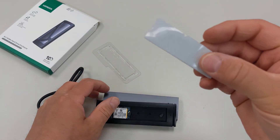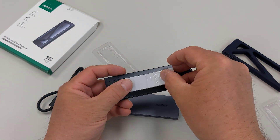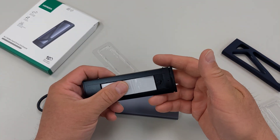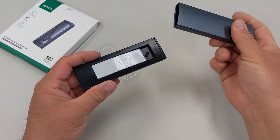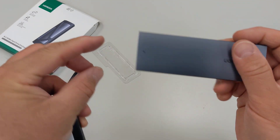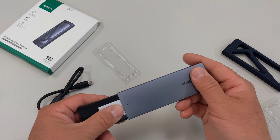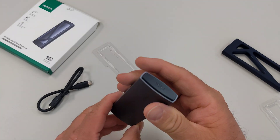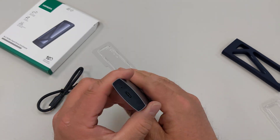After that, there's this thermal block — I'm going to put this cushion right over top of the drive. That will give it some cushion for being in here and also protect it from vibration and act as a heat transfer medium to get heat from the drive up to the aluminum. There are also arrows — one here and one on the case — so you know which way to put this together. It's super easy to get this apart, I really like it.